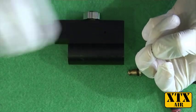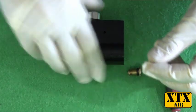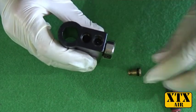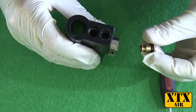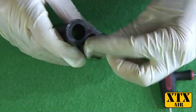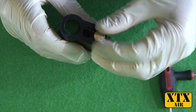It would be a good idea to put a drop of suitable o-ring lubricant on the o-ring. Make sure the little ball is nice and clean with no dirt on it, then drop that into the centre of the o-ring. This has obviously been cleaned and pre-lubricated, so pop that back in and tighten it up, making sure that the little ball bearing stays in place.